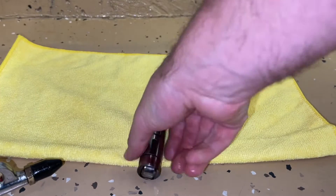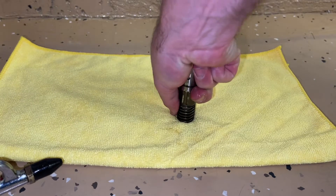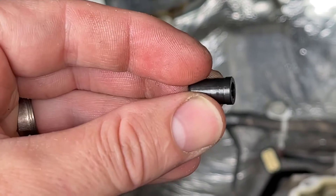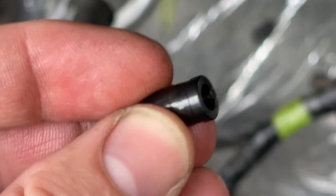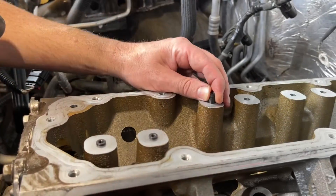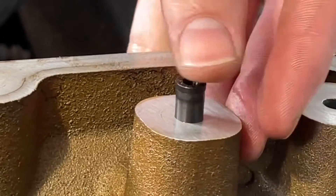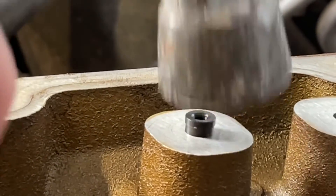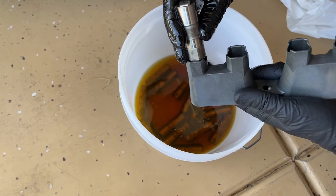The guide pins themselves can also fail and wear out. There is a way to delete this system, which involves taking the cylinder heads off and putting in a new camshaft and everything. Check the video description — I'll show you the full walkthrough. It has to do with these little plugs. What you're going to do is put each of these plugs down into those passageways and tap them in, so oil pressure doesn't go down there. You're also replacing the collapsible lifters with regular ones, just like the other ones already in the engine.